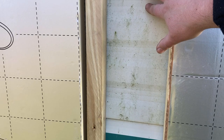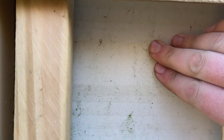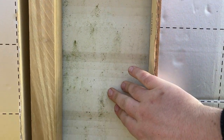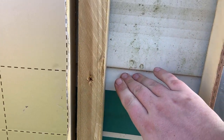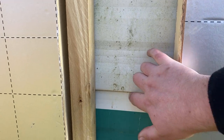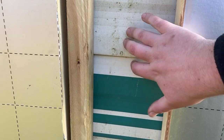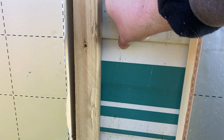As you go around, you can get a pretty good gauge just by pushing. On the metal here you'll see there's lots of flex, but as you move down you'll start to feel a lot less flex — and here, particularly here, there is no flex at all. We can see that these are two metal panels on this caravan. They had to have something to screw into, so we knew that just behind here there is a batten as well.